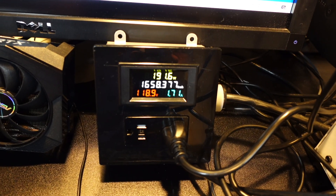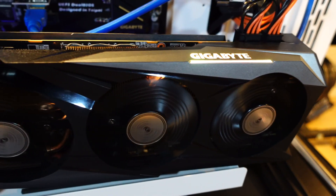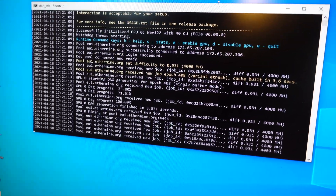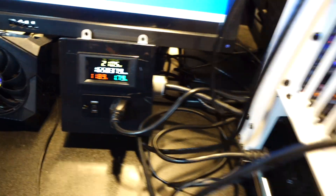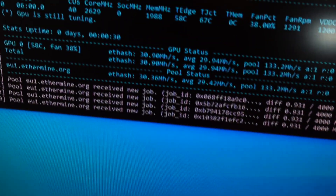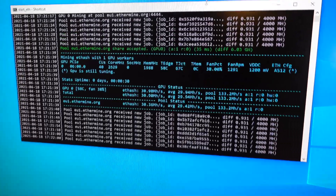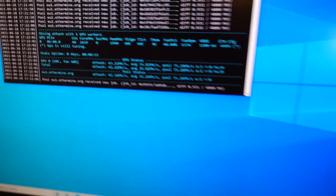You can see that wattage already ramping up — we'll keep an eye on that. All three fans of the GPU are spinning. We'll see what Team Red Miner comes up with. Finished building the DAG, mining to Ethermine. See that wattage is already up to about 210, which means this GPU is pulling about 180 watts right now. Let's see what kind of performance we get for that. Right now we're up to 30.9 megahash. Hit S to force the stats to refresh — 43.2 megahash running stock.